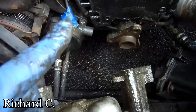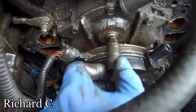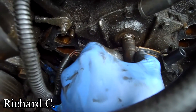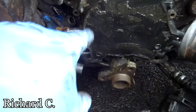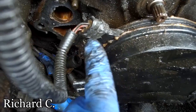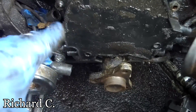When you do that, there's a little thing you have to keep in mind — that thing there goes in this way, because this connects to the water pump. Now this is the Optispark — whatever you want to call it — and as you can see, this thing already had some RTV around it to seal it.